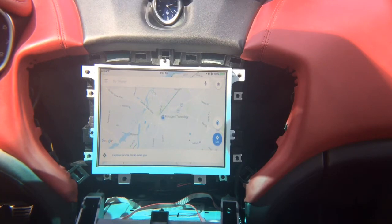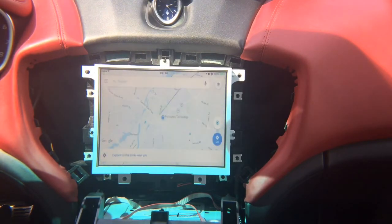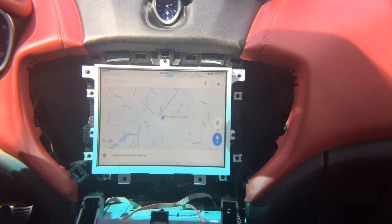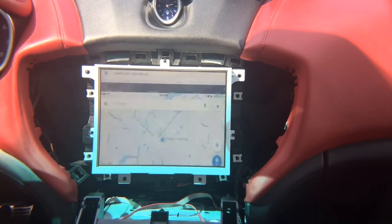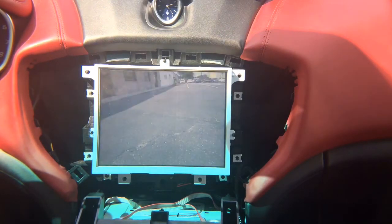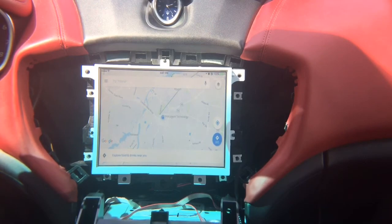When you're in that mode, the up and down buttons on the back of the steering wheel change modes — left, right, front, rear camera. You get side cameras, front camera, and rear camera — all the inputs. When driving with Waze, putting on the left turn signal activates the left camera, and the right turn signal activates the right camera. When you put the car in reverse, the reverse camera has priority. In drive, the front camera works up to 10 miles per hour, and you can force any camera you want while driving.